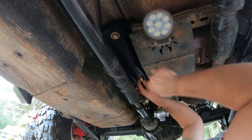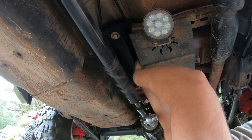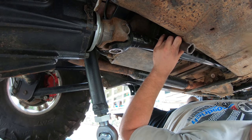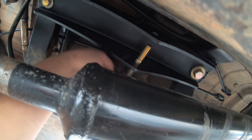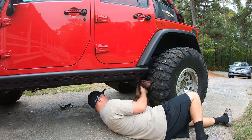To get this bolt in we need one that's shorter because it's hitting the cross member. What we had to do was take a long pipe and just hammer this body cross member in just a little bit — it's part of the body up there so it's pretty soft — and that gives the proper clearance to remove and reinstall this bolt. We're now going to remove one of the rear lowers and then cut off the lower frame bracket.